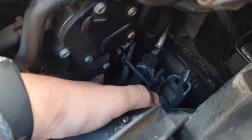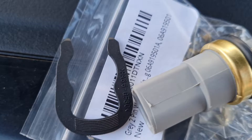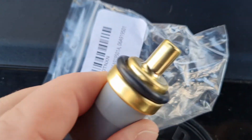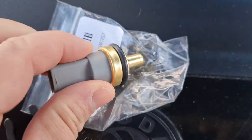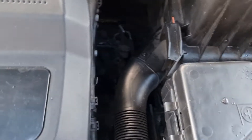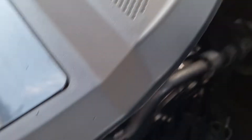If you feel round to the bottom where this wiggly finger is - I can't really film this - there's a little sort of tab. You can pull it out with your fingers or get a flathead screwdriver or something to get underneath it. You pull it out and then the whole sensor should pull out with an O-ring. When you pull it out and there's no O-ring on it, you need to fish it out. The right thing to do would be to drain the coolant, because as soon as I pull it out the coolant's going to go everywhere. I'm going to use an old takeaway tub to catch the coolant.